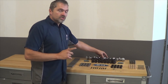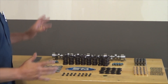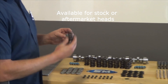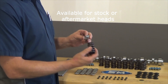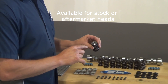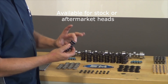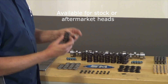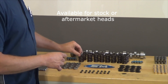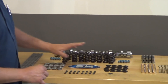Now, if you've already gotten one of our camshafts, or do get one of our camshafts, go over and look at the little video I shot about camshafts. But we have complete packages. What's different about our complete packages? We have this dual spring — an American-made spring, made for us — and we have the correct titanium retainer. This is not parts pulled from one source here and another source there. This is machined and toleranced properly. This is the same spring and retainer that we use in our own engines, matched with the proper keepers, spring seats, and valve seals — everything.